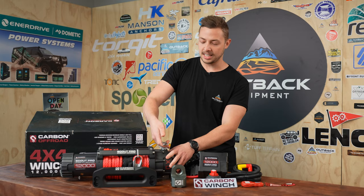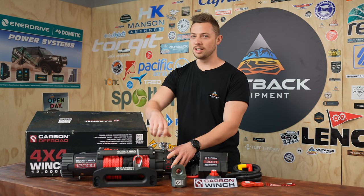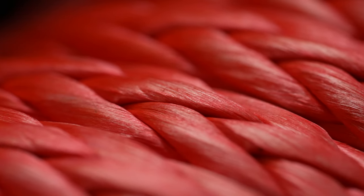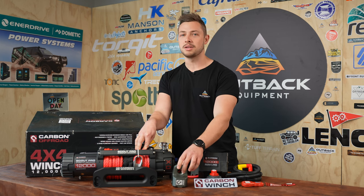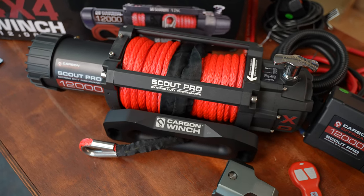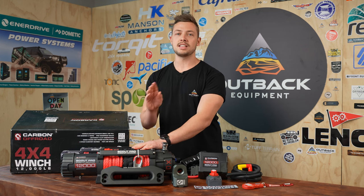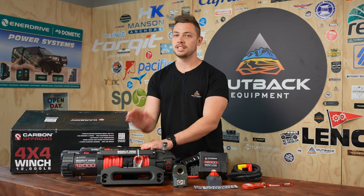A nice feature with this is the clutch click. Unlike most winches out there that have a lot of stickage, this one is nice and easy to use. On the barrel of the winch is a 12 mil synthetic rope, along with the 16 ton thimble, which is soft shackle compatible. This whole system is actually IP68 rated, meaning you can run this winch at 1.5 meters for up to 30 minutes. The piece that allows this is the Gore-Tex style breather, which allows air to travel in without allowing any moisture — pretty unique to this winch.